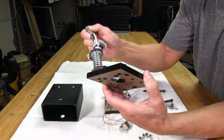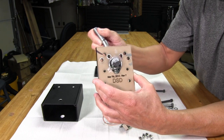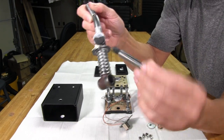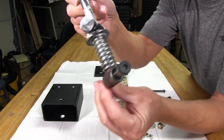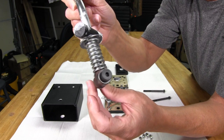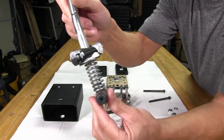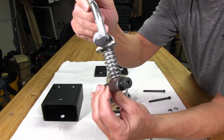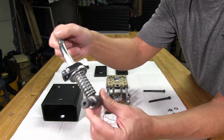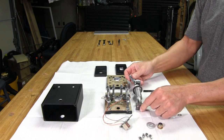I'm not saying this is going to break — it's pretty robust, actually. I really like the structural integrity of the whole assembly once it's in the box and tightened up. The shaft pivots on a machine solid bolt with threads on the end. There's actually a little bit of play in there, but you don't want this bolt to be really tight because that will cause friction on the shifter. Once it's inside the assembly and the spring is compressed, it compresses down against this pivot bolt so you don't have any upward or downward movement. The bent shaft is tough, and I like how everything is nice and solid.